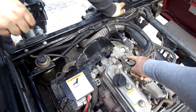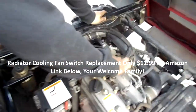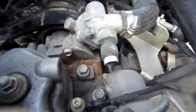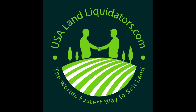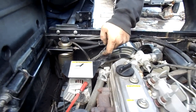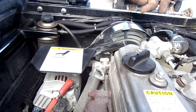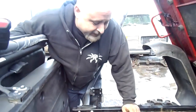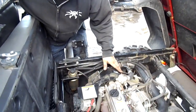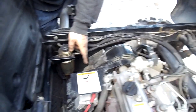That switch is usually a sensor telling you that it's overheating. You can see a little bit of belt movement there — you can feel it with your finger with the engine off. We want to get a little more tension on there. There's one bolt on each side holding the cover — we'll get underneath with a 10mm to get those loose.